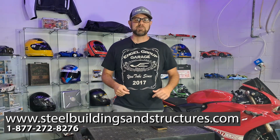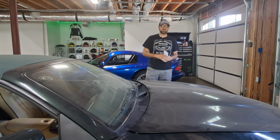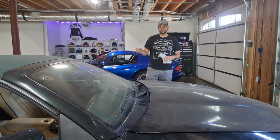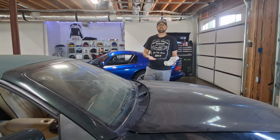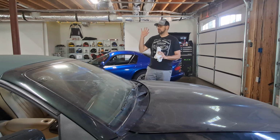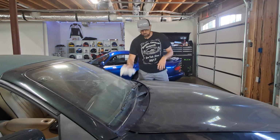All right, let's get back to our project. So we have her in the shop and we need to start doing a few different things with her. One is making sure that the battery is fully charged. Now, if you notice from the earlier part of the video, it was dinging, so there is some power to her, but she has not started yet, and I don't want to turn her over until at least I check that there's oil in there and that the fluids seem to be okay. We also need to make sure that the battery is fully charged, so we've got to do all that. The first thing that I'm going to do is check the oil.